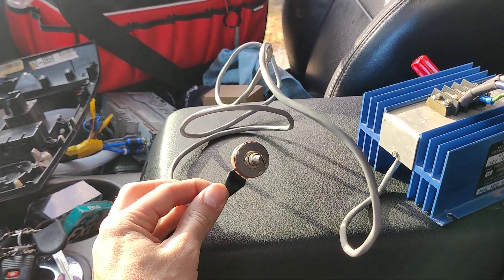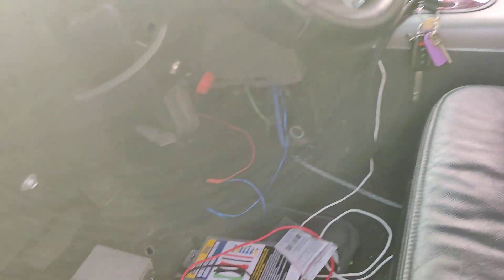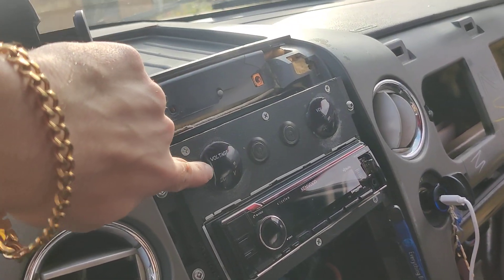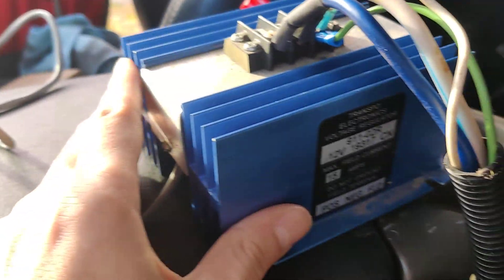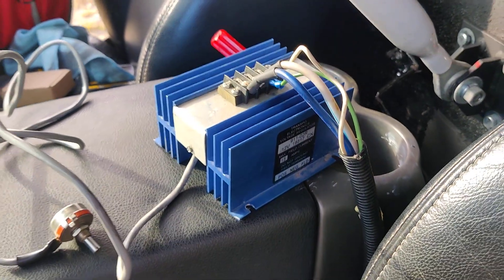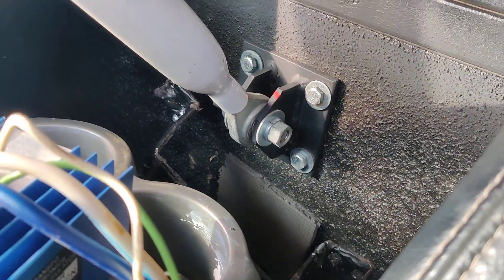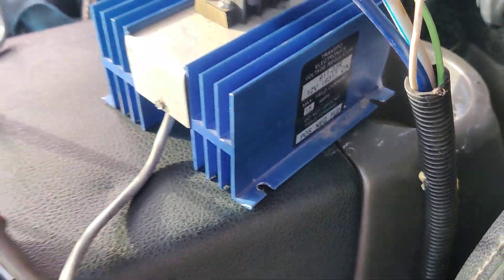This is a little turn dial, about 150 bucks, so it's not super expensive and it is fairly simple. I want to say this one right here was about 150 but it is an older regulator — I'm going to keep it as a spare. All you really need with this one is a voltmeter, something to read your voltage, that way you can tell where you're charging at and where your batteries are sitting. It's literally two wires — positive, negative — and you can either have one or two field wires depending on how many alternators you have. You really want it to be within about six feet of your alts, and I am going to mount it right back here where the fat boy was. It has some little screw holes in order to mount it wherever you want.